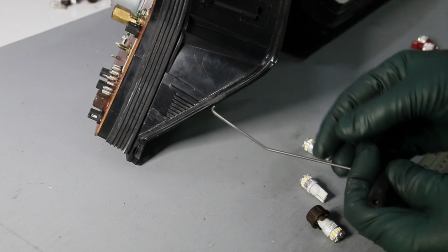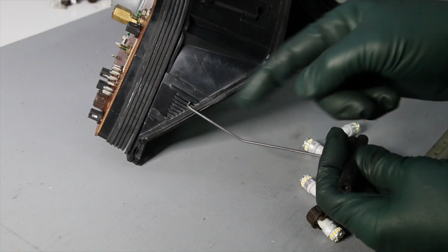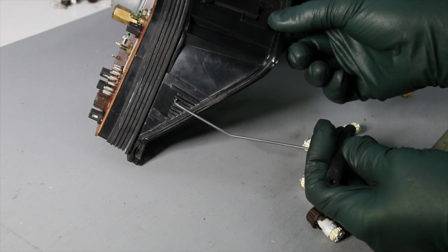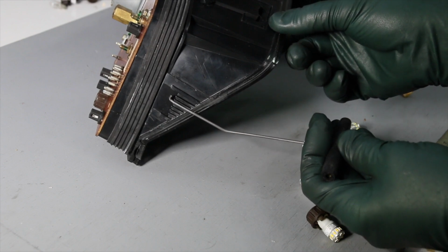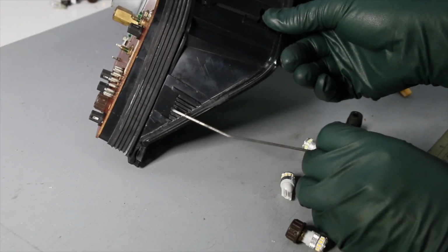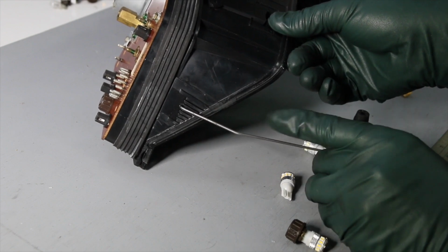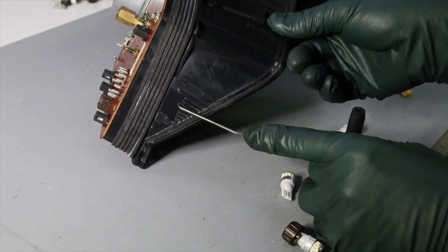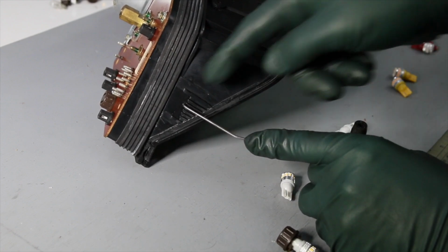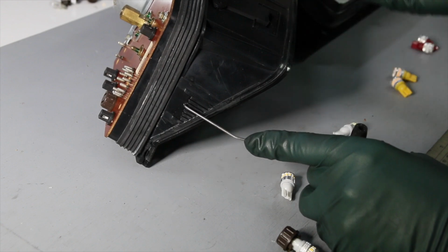You rotate the tool and slide it in between the padded dash, and you get about an inch in, maybe a little over an inch, and then you rotate it 90 degrees, and you can see it hooks right into these grooves here. And you do that on both sides, then you side load, you twist these out so they really force this hook into those grooves, and then you pull the housing out of the dash.